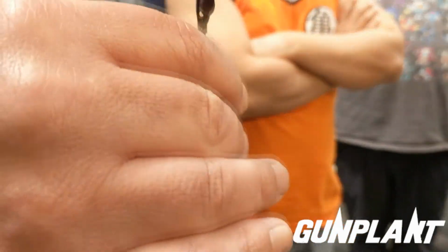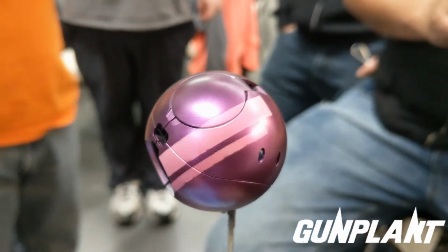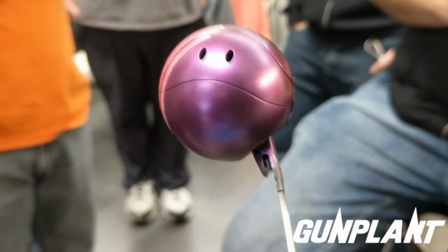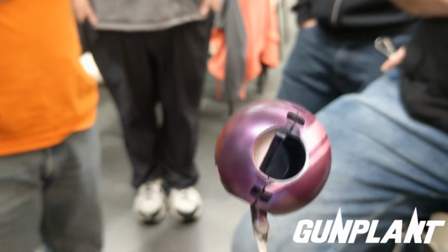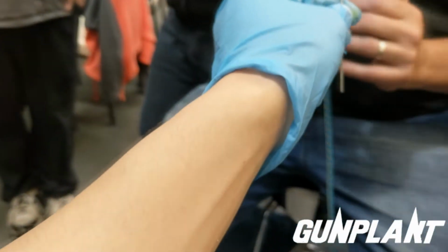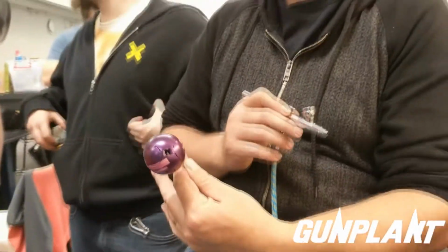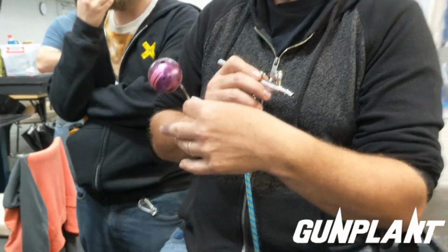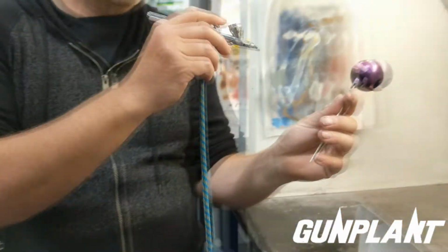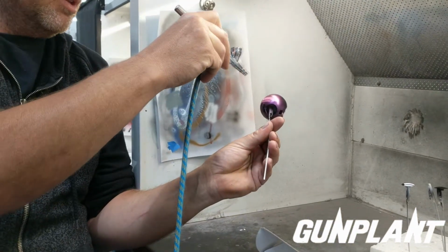I like the black. It's pearl. Pearls in general are like that. Same with white pearl. So you don't put white pearl over anything else but white. I made that mistake once, because I started spraying it and I'm like, why isn't this white? So with a white pearl, you always use the white base because the white shows through. You just want that luster. That's what the pearl gives, is that luster. So it's basically translucent metallic. Pretty much, yeah. You think of it like that.